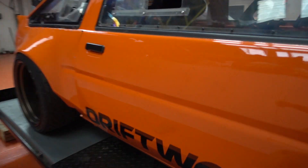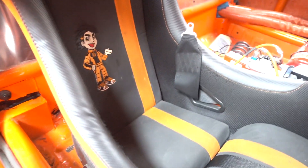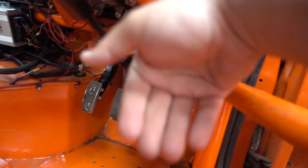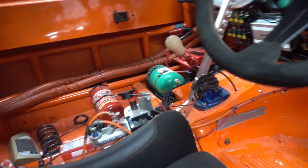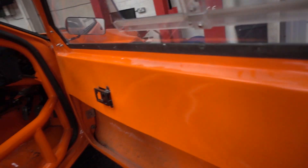Just take you inside. A couple of changes: we've moved the seat slightly forward just to improve Phil's driving style — still on the Cobra seat, which is very nice. We've removed the pedal box and gone for more traditional pedals, so the pivot point has changed — instead of pressing down you now do that sort of motion, easier to drive. Phil never really got on with the old setup. New steering column as well — we found the joint had play in it when we took it apart for the rebuild, so we completely redesigned the whole system and moved it forward to coincide with the driving seat. Because we've saved weight, and as part of the BDC rules you don't have to run a passenger seat, we've moved the battery from the back of the car into the passenger footwell just to keep the weight distribution as it was before — which is quite important to try and keep it driving the same.